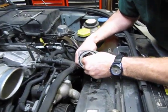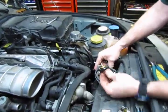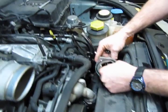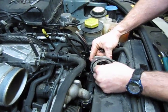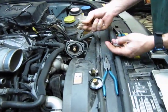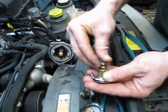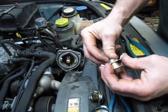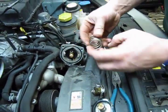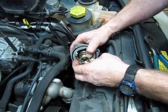Alright, we should be okay. I think that'll work good. Alright, so we've got your seal itself. Make sure that pin is in the right location. Make sure it moves free. You're going to take your inner spring, fat end down, and insert that into the retainer collar. Your lower spring gets mounted directly on that.